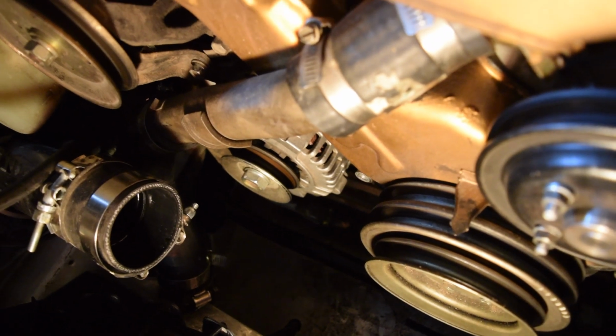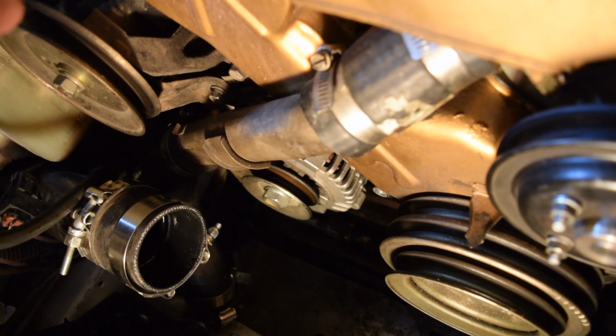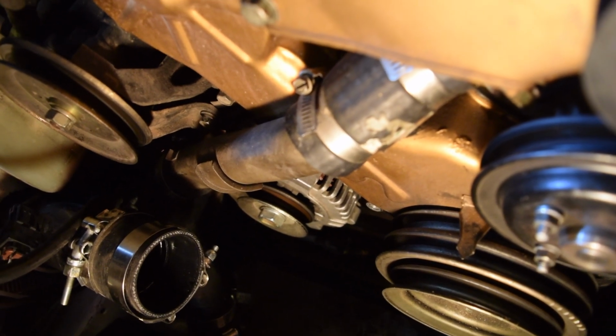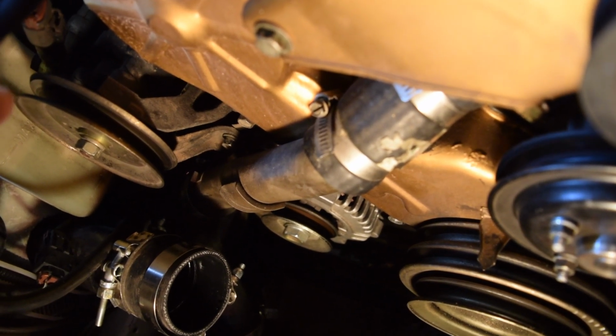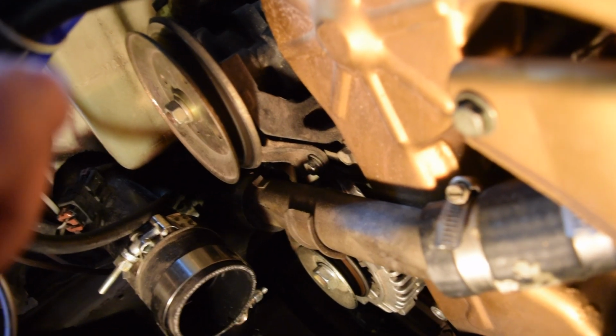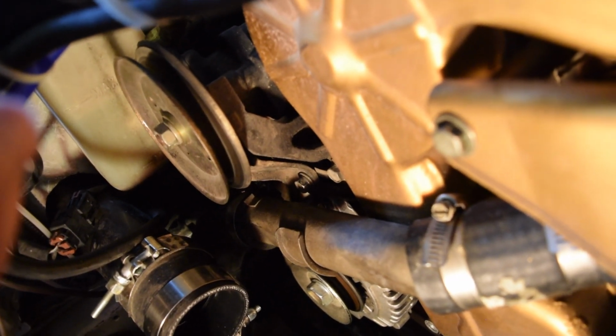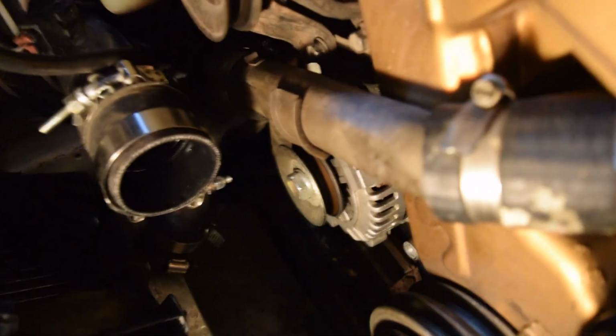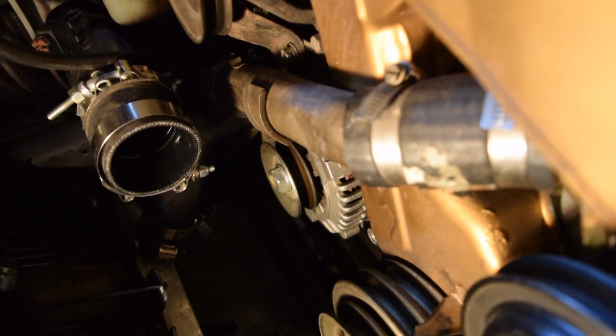And now we have the alternator hanging. It's got 2 bolts on top, one on the front and one on the back. And these are notoriously difficult to reach. So I would suggest getting a stubby 12 millimeter for the rear, because that one is very hard to get to. And then the front, I believe, is also a 12, but you should be able to get to it with a regular wrench. A stubby, again, will probably help here, but it's just kind of how it is. It's hard to see on camera, but you'll be able to see it really easily in person. Right there is just a bolt, and then the back is the same way. So we're going to go ahead and undo those 2, and then this will let the alternator fall down. And once that happens, we can go ahead and unplug all of the electric connections to it.